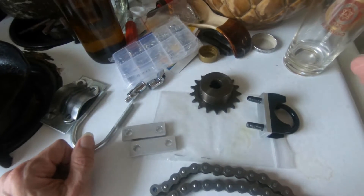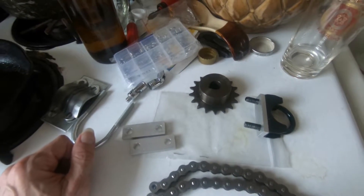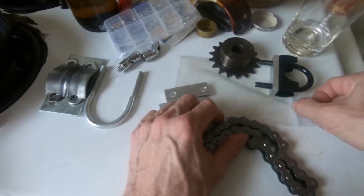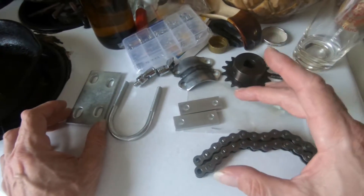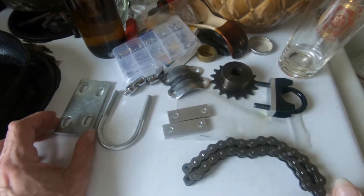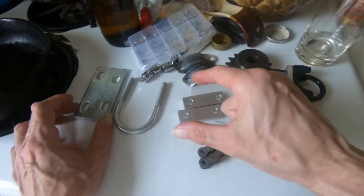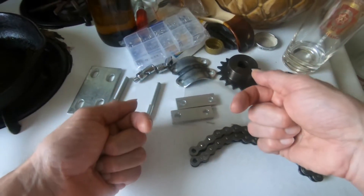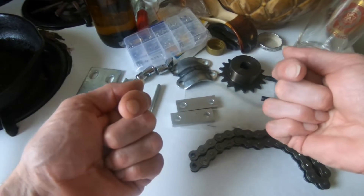The problem with that is it moves the front of the motor even closer to the down tube. The mongoose dolomite doesn't have a lot of room to begin with. The other problem is that the diameter of the down tube is wider than the stud spacing on the engine — in other words, you can't put two studs around that tube and into your engine. The tube is too wide.